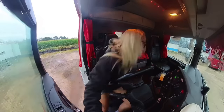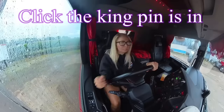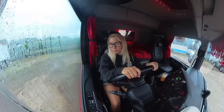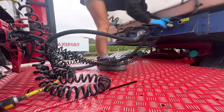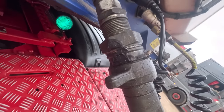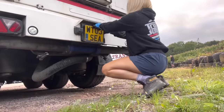I always get out and give it a little check, just to make sure the height is right, and just in case I've missed something. I am clear, but it has been dropped very low. Then I give two pulls forwards, just to make sure it's definitely in. The first thing I do is put the safety clip on the kingpin. My arms are only just long enough to do this. Then I screw on the hydraulic pipe and plug in all my Susies. Whoever had this trailer last left a big dollop of fifth wheel grease on the hydraulic connection, and now it is all over my gloves. Then I can wind the legs up and stow the winder away. And last but not least, I can put my number plate on.